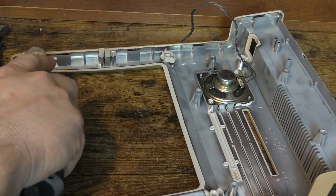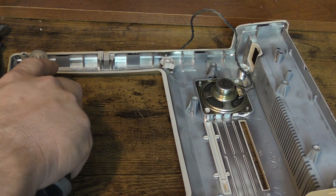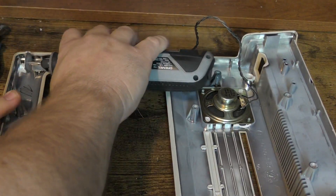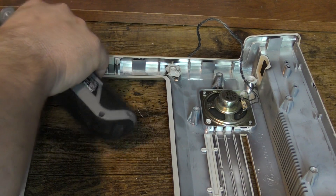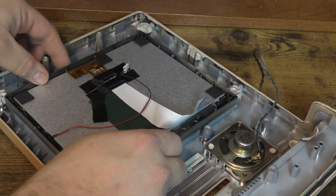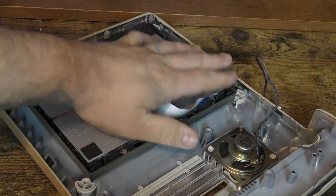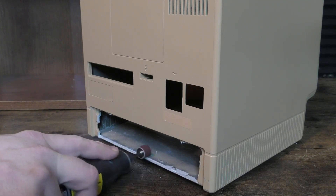We're going to cut this down so we can properly mount the monitor in place. I'm going to temporarily mount it in a reversible way — no screws, just a little glue, so I can pull it out and put a bigger monitor in later. This Mac SE's CRT screen is now in my Mac SE 30. The analog board was acting up and had a bunch of issues even though it didn't need to be recapped, so let's just do something fun with it.